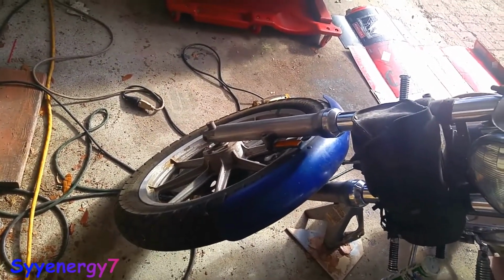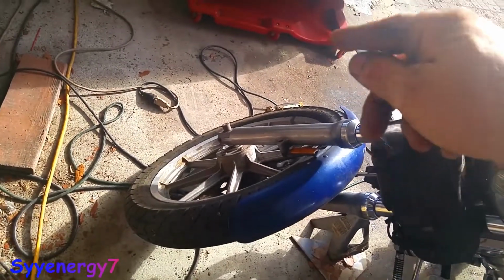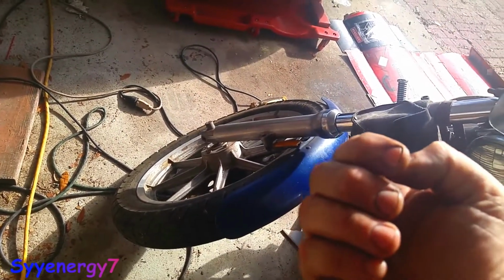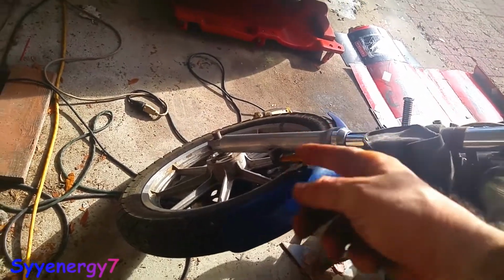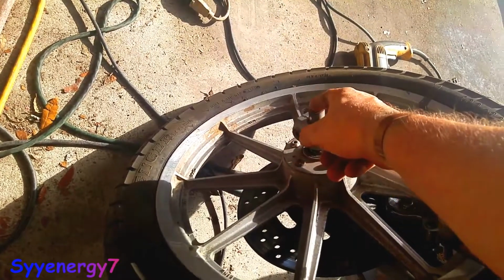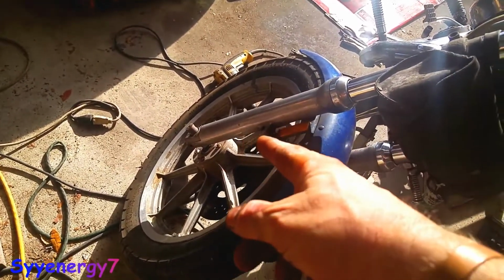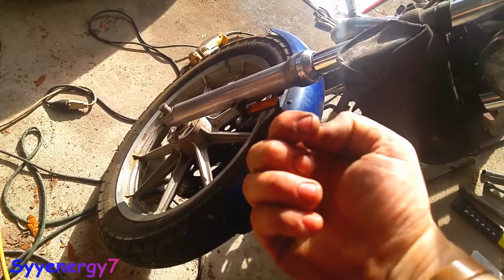And personally, I bet they could make the axle with a little port hole where you can have a grease fitting, say here, and maybe just take it out, or put a Torx head bolt in there after you use the grease fitting. They should make this in the aftermarket, where there'd be a little bit of grease coming through inside the axle, a tiny hole. I mean, 1/8 inch.